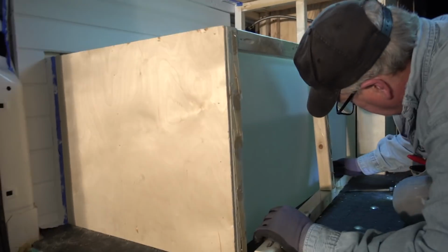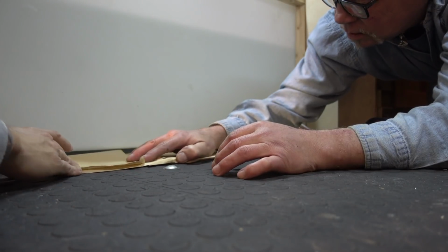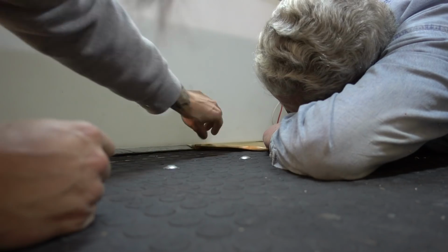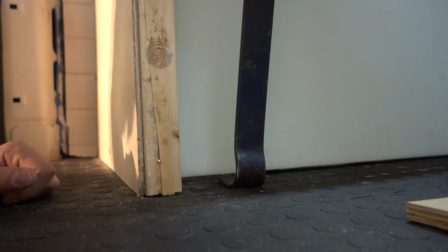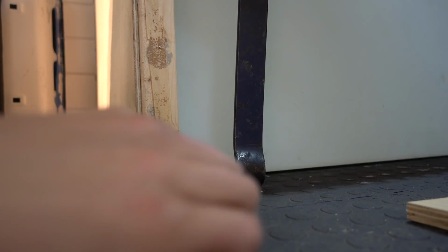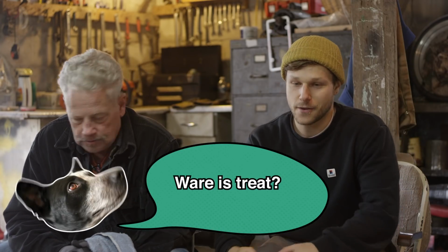We had a bit of a headache with the freshwater tank because the lines are all run to it. It's framed in really tight. So we had to pull all that out and open it up and then shimmy it underneath, jack it up. Those heat pads are all adhesive. So we had to slide the pad under there and then lower the tank back down on it to make it stick, and then fish the wires out to run to the DC. That was a real treat. So that was a pain, but it did work to keep the tanks thawed,